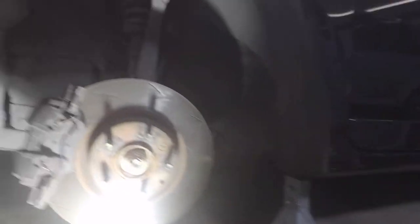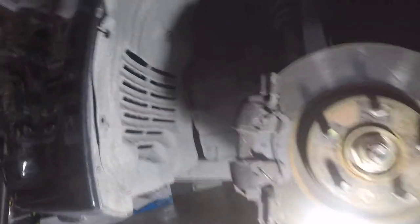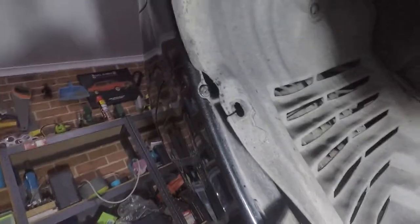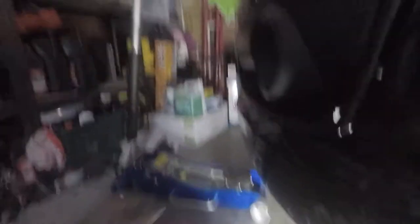To get this resonator out, the easiest way is to jack your car up, put it on some car stands, and get your airbox-side wheel off, because you'll need to remove the shroud in front of the wheel. It's held in by about five plastic clips, and underneath there are four screws that also need to come out. Once you've got those out you should be able to just pull the shroud aside — watch out for all the crap that's going to fall out — and you'll see the resonator in here, which is held in by three bolts. The first bolt is just up in here; they're all 14mm. The other two bolts are a bit tricky to get to, so I recommend removing the shroud around the fog light just so you can see a bit easier what you need to do.